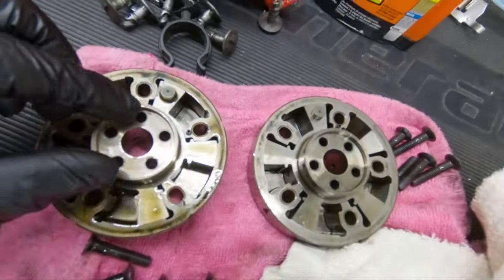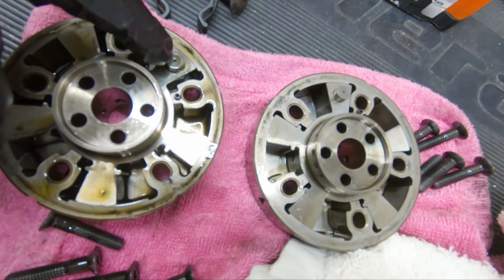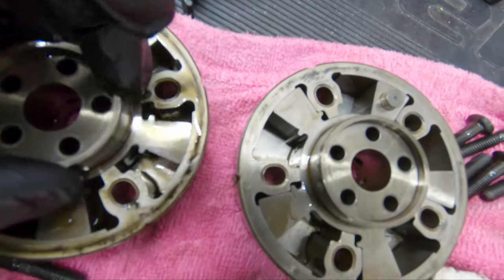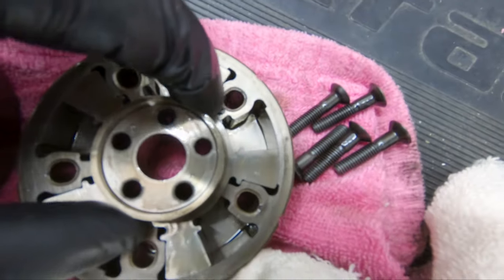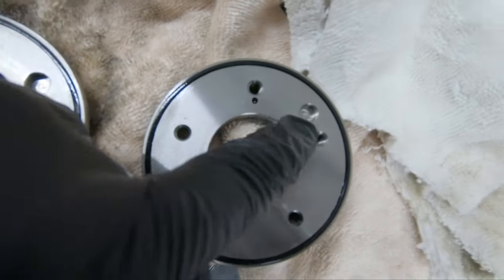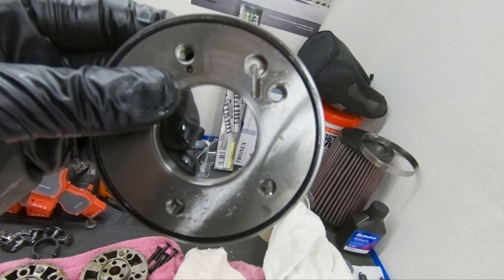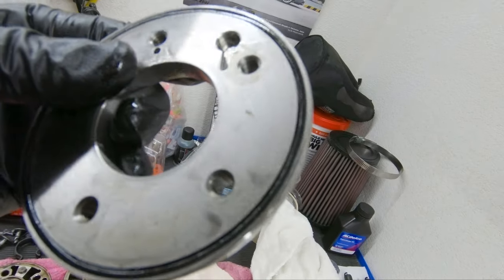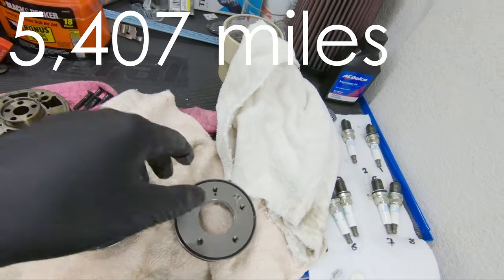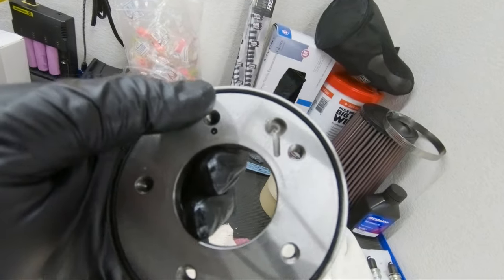Separated the mechanical adjuster. Here are the guts — this rotates like it should. There's a little spring activation, and behind the spring is a little plastic washer — you don't want to lose that. This thing here moves freely. That part right there connects to this black dot, and this is what is prone to wallowing out. Just by visual look, it still looks in new condition. I don't see any signs of wear anywhere, so that's a good thing. I'll post somewhere up here the miles I've driven with these JHM mechanical adjusters — they've definitely held up so far.